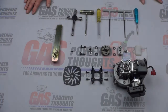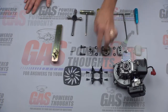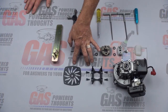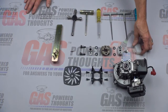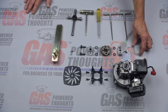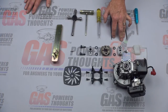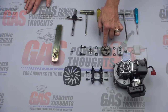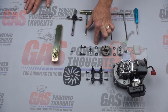Next up we're going to get the motor ready. You're going to need a Zenoa RC format motor. The kit comes with a motor mount, the bolts needed to attach it, and a fan cover. If you want to pull off the pull starter you can replace it. You need a heat deflector made by Hostel RC. You'll also need a Zenoa clutch — this is the plate for it, it's a standard RC car clutch. These are the shoes for it, spring mounted. The flat washer and the spring washer — those are standard.